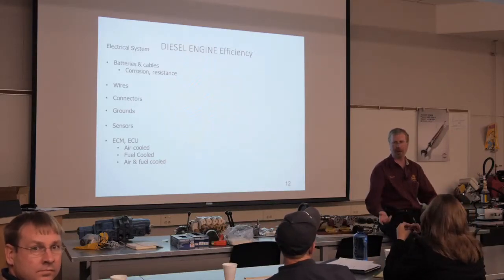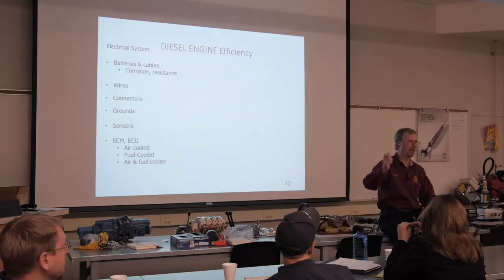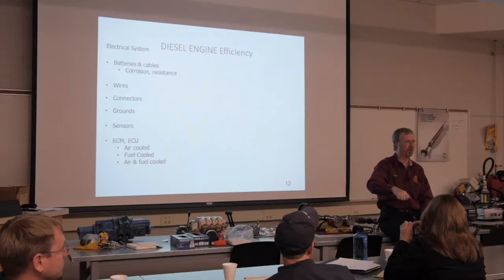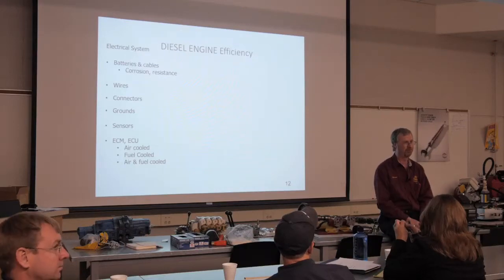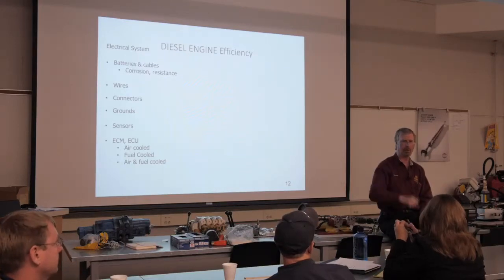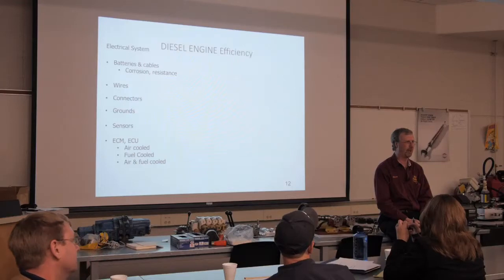A lot of your passenger cars, when you open your trunk, you have this little light that comes on. Well, there's a little switch in there that if you close the trunk and the switch doesn't turn the light off, well, it's a parasitic drain. You don't know that because the trunk's closed. Same with the hood. A lot of tractors, semis, they've got extra lights on them.